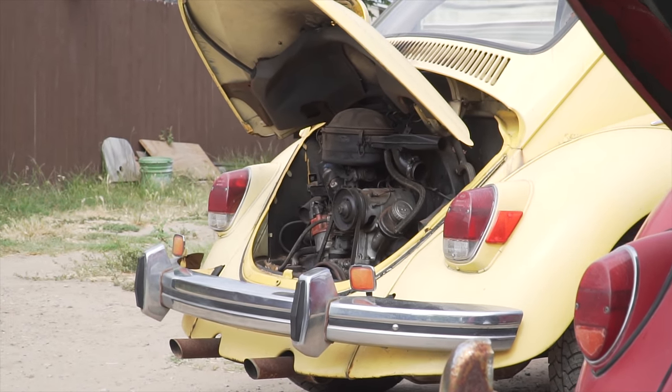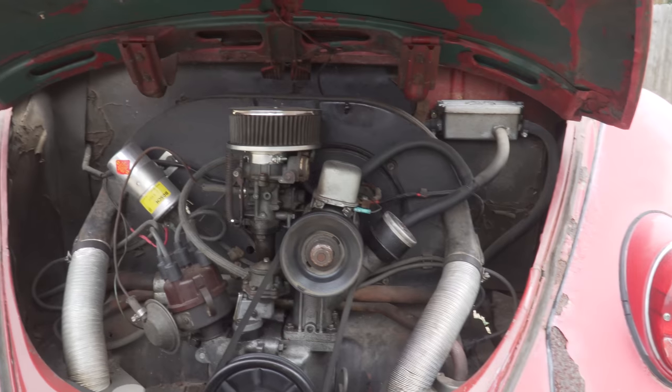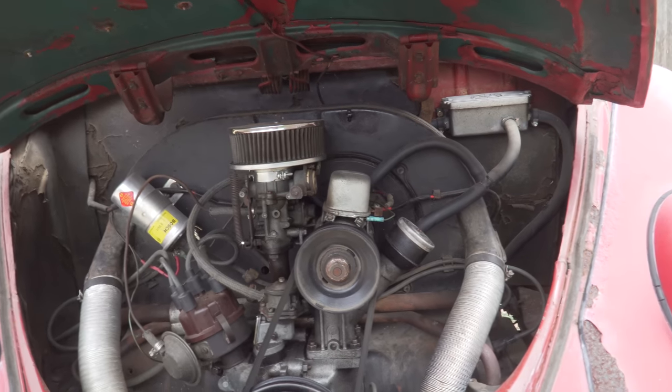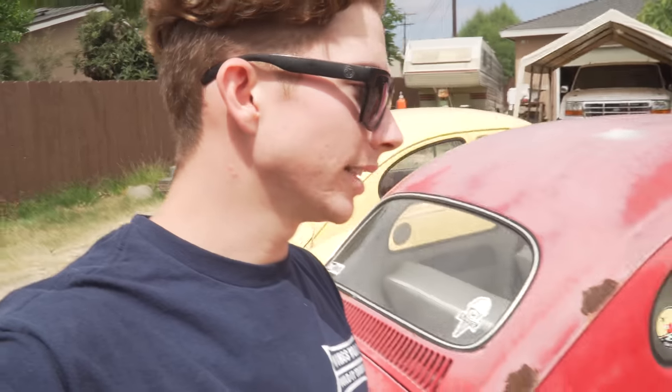The other differences are obviously motor size. The '64 has a standard 40 horsepower 1200cc motor, so I would have had to upgrade it to a 1600 anyway — you can find used 1600 motors for about a thousand dollars. The other main thing is the '64 would have had to get swapped to 12 volt. You wouldn't have to, but to run a 1600 with the big lights you're going to throw on a Class 11 car, you'd basically need to swap to 12 volt. These '70 cars are already 12 volt because Volkswagen switched in 1967. The price alone just to swap the motor and convert to 12 volt on the '64 would have cost the same amount as the whole '70 car did, so it just makes more sense to start with a car that already has those things.